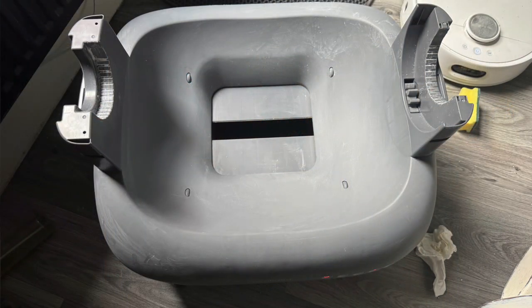Welcome back to the channel. Today I'm going to do another Neocasa video where we're going to replace the infrared sensors. About a week ago I noticed an error — the empty light was flashing, there was plenty of litter in it, the bin wasn't full either, but the trap door was kind of stuck open. I tried manually closing it and it still didn't work, throwing an error all the time so it wouldn't do any emptying cycles. I looked online and on some Facebook groups and it said to make sure your infrared sensors were clean — I did that and it made no difference, so I reached out to Neocasa who sent me out some new infrared sensors.